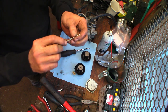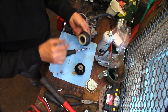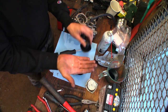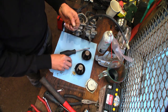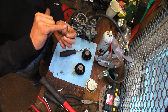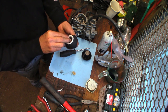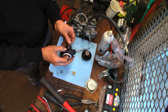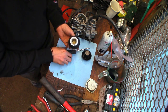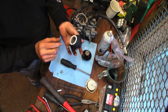Check underneath the head of the needle — this area here is what sits on the slide. Inside the slide — the vacuum piston — there's a little shim, so make sure your shims are back where they're supposed to be. Some needles have grooves you can adjust for different altitudes and different jetting, but we don't have that. So we'll just transfer it to the new one with the shim that was in the old one. Drop the retainer back in — they always fall upside down. Locked in, good and solid.